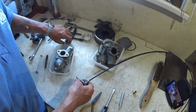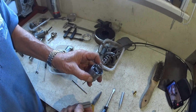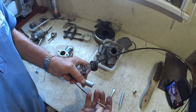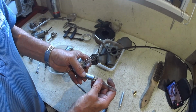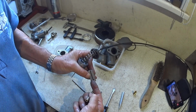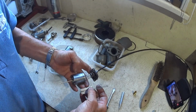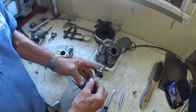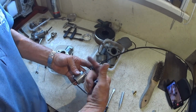Oh, just if anybody's ever seen the choke mechanism, all these slides have this cutaway here, and this is the choke slide. And what comes with the choke slide is this guide for the cable, keeps the cable off the spring. That in there. Same idea, cable goes through and it hooks over the end, through that hole, down, and latches in there, obviously over this, through there, and the choke is opposite to the throttle slide. When you twist the throttle against the spring, you're obviously lifting, but the choke is always in the on position and you pull it off.